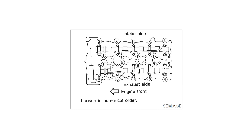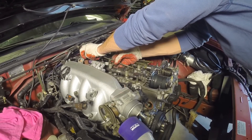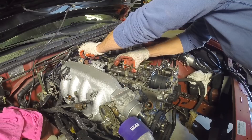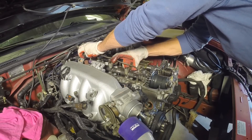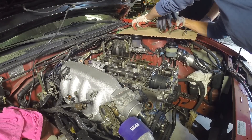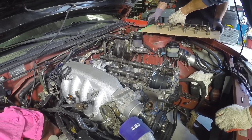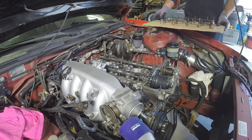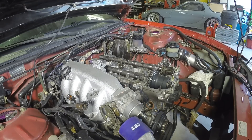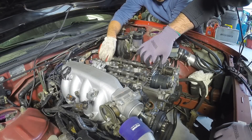Here's the crisscross pattern that you need to follow. With all the bolts loose, remove the caps. I always try to remove a few at once so as to not have to remove the oil tubes on their own, but take your time with this as you don't want to drop or damage any bolts or cam cap covers. Remember to keep track of where the cam caps go because they're not interchangeable. You may need to persuade the cams just a tad to unseat them before they slide right out — it helps to have a third hand here to hold onto the chain.